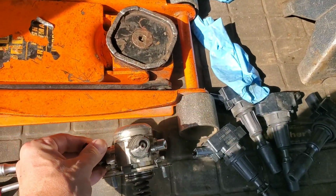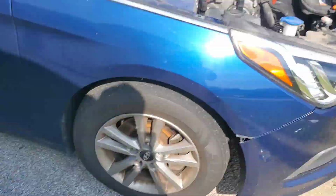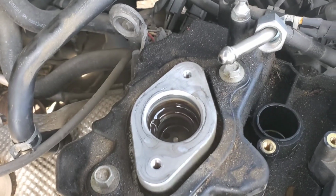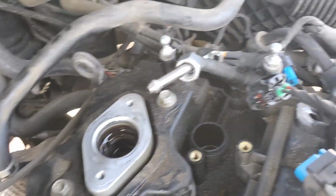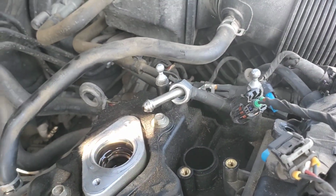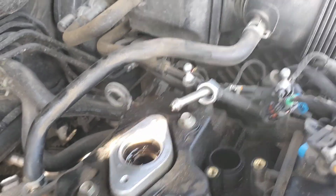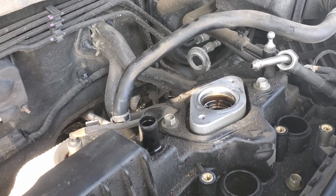But you just take those out and try to loosen them somewhat evenly, a little on each side, because there is a spring on there. Also, you want to be very careful not to drop anything down into that hole. But otherwise, that line right here, that stiff one, there's not much movement you're going to get on that, so you're going to have to kind of work around it. You can get the fuel pump out pretty easy, but the valve cover, we're just going to have to see how it comes out, what we've got to do.